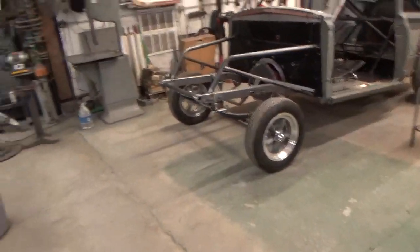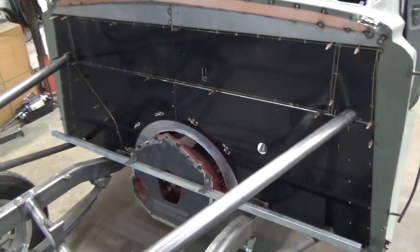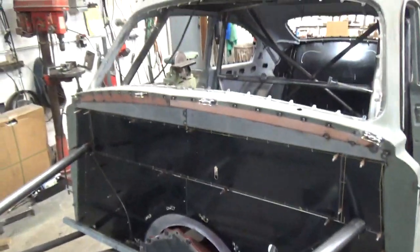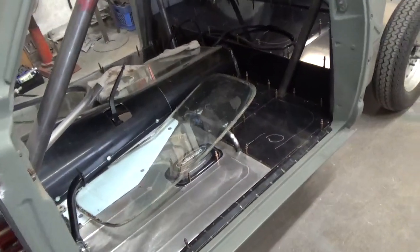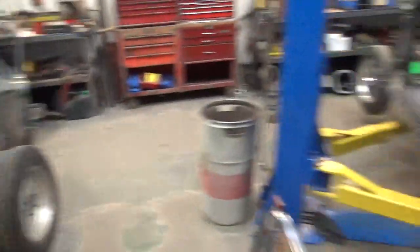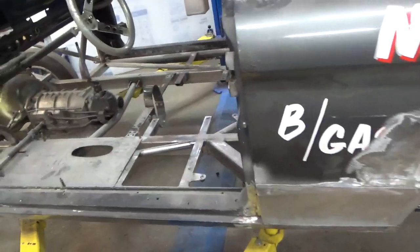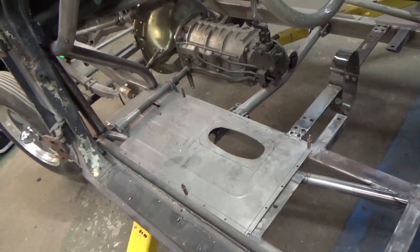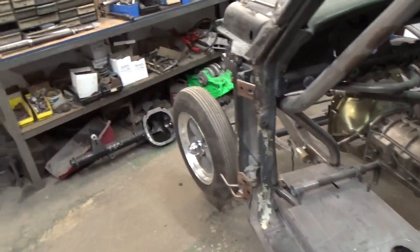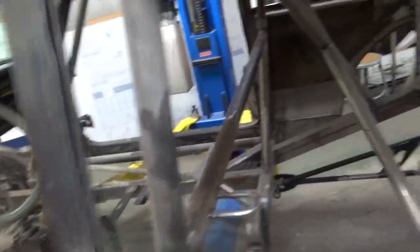I wanted to share that with you. As you can tell, we got all the tin works roughed in on this one. I'm ready to fit the windows and then this baby should be ready to go for powder coat and paint. I'll bead roll the tin work as I pull it out. The Falcon — I got the quarters all done, got them fixed, straight and sort of good. Put one piece of steel in the floor. This one's ready for tin work, that's why I got it on a lift. I mounted the front end, got that done, mounted the radiator, and basically it's tin work and a little bit of finish welding underneath and it's good to go.